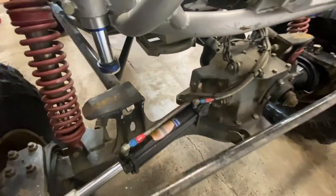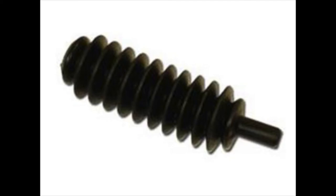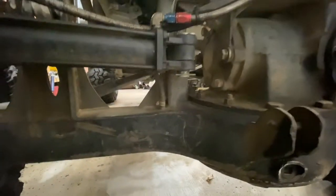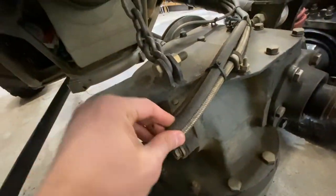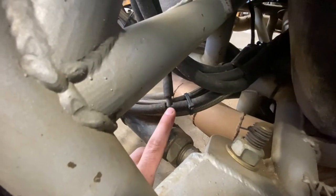Next I'm going to talk about the axles. I tried those little vent bellows where you connect them to the vent and the bellows inflate up and down — I never had any good luck with them. The axle would pressurize and I had leakage from the pinion and different spots. So I went away from those completely and decided to use a regular hose. It's not high-pressure hose so it's cheap to buy. I have one for the front axle and one for the rear axle, connected together with a T-fitting.